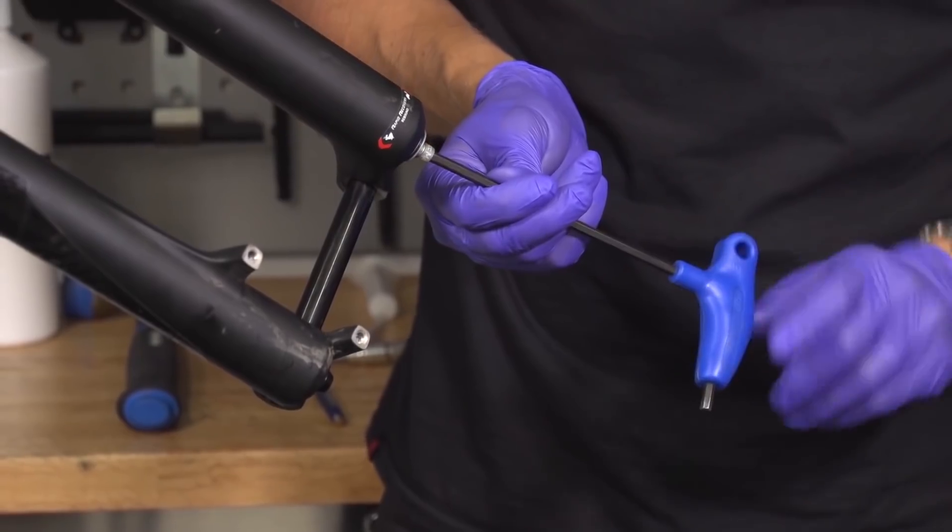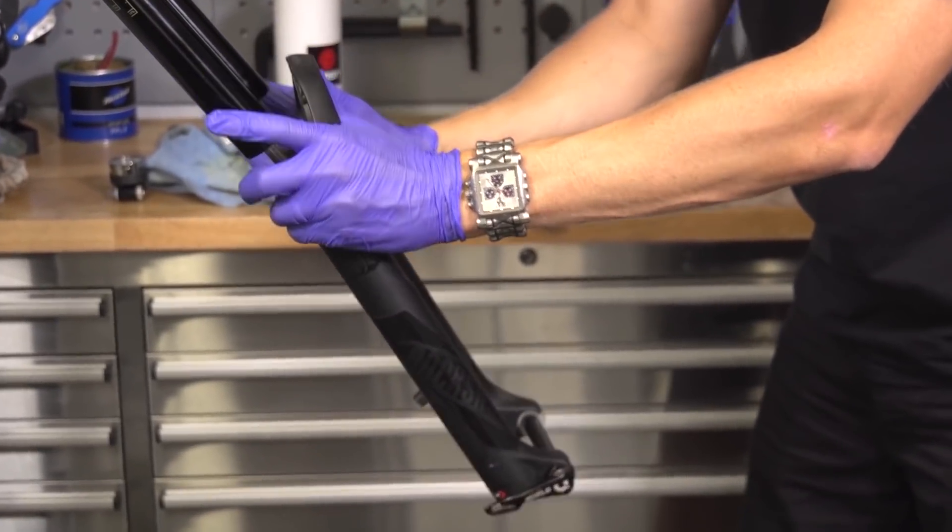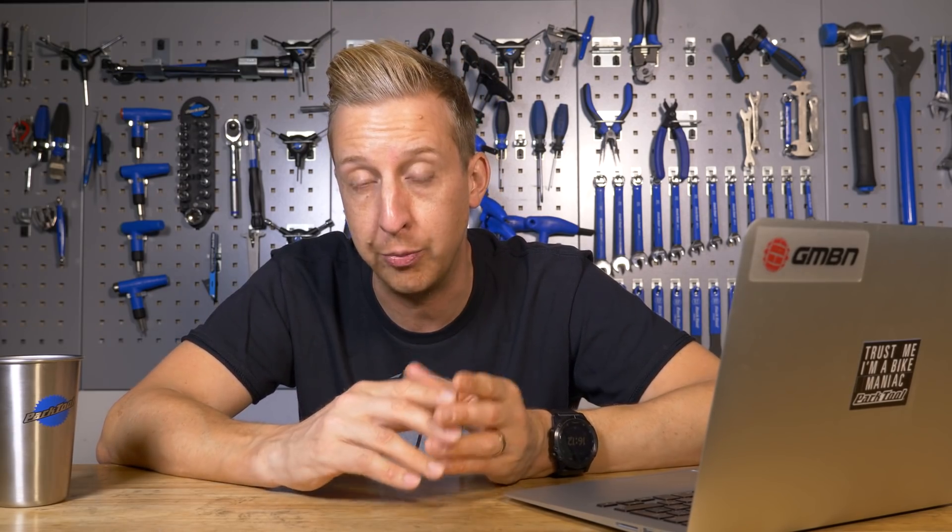That fork is quite simple. As far as I know it's now the Dirt Jump 1 and Dirt Jump 3. The Dirt Jump 1 has an oil bath in it; I don't think the 3 does. The principle for taking a fork apart is the same no matter what suspension fork — they have a slider, a stanchion, and a set of bolts that hold it all together. At the bottom of your fork you'll have either bolts or nuts that need to be undone, and then you shock those to loosen the rods from inside the lower legs so you can slide off those lower legs. At the point you undo those bolts or nuts, if there is any lower leg lube in there, have something underneath to catch any oil — metal cups, old plastic cups. The oil inside is purely there to lubricate the bushes. It's a coil sprung fork with a damping cartridge inside, which can be replaced as an entire unit if it fails.